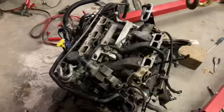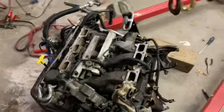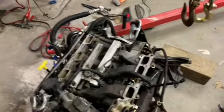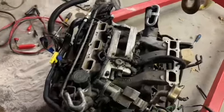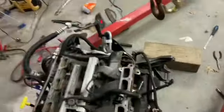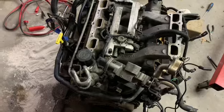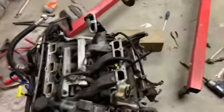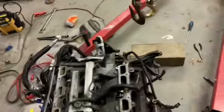And I put the timing gears and everything in place like, as far as I know, they're supposed to be. Number one was up, at least from what I see is number one, from all the research I've done and knowledge. Even that plug wire runs over to where I thought number one was, but everything's lined up like it's supposed to be, so I don't know what's binding, but it should turn over easy. Spark plugs out of it, full batteries, whatever. Jumping it. Shouldn't be this hard. It ain't no super big engine.